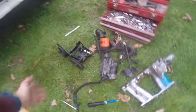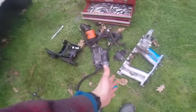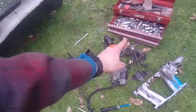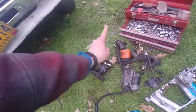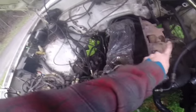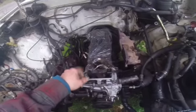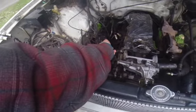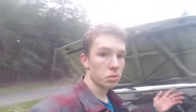Here's my glorious pile of parts. I got the exhaust manifold out for painting — I can bring that up to the house and paint it. Got the starter, power steering pump, oil filter, air hoses, and fuel pump. This whole side is clear of mounts and brackets. I just have the engine mounts left — I'm trying to figure out how to get this thing off. I'd love to get that off tonight, but I'm kind of running out of time. Once I get the engine pulled out and drop the oil pan, it should be good to go.